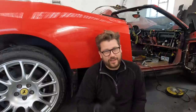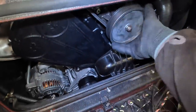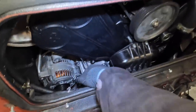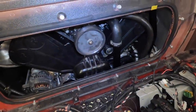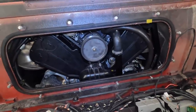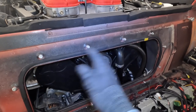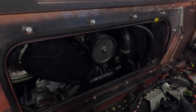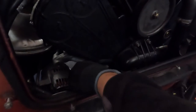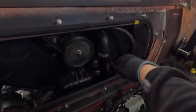So we're going to have to order another bolt from Ferrari, but that's not too bad because I've got to get another set of gaskets anyway. With the belt off, that means we've got no movement at the water pump, pulley, alternator, and the water pump belt was also driving the power steering belt, so that is also eliminated. We've also got the AC pump down there.